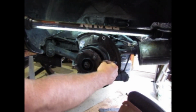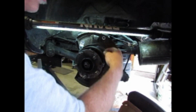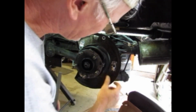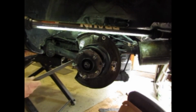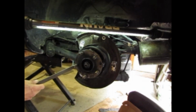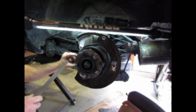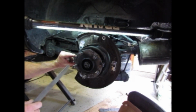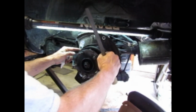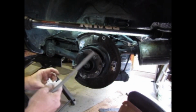Quick inspection, but everything looks pretty good. All right, quick check. Adjuster's all the way up. Lubrication is done. Springs are secure. I've tested the adjuster, it works. You want to make sure over here on this side that the levers are in both their notches. These ends of the shoes should be pretty close to this stop here. Try to get them even on the backing plate.